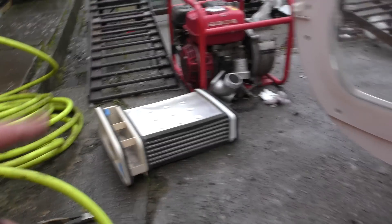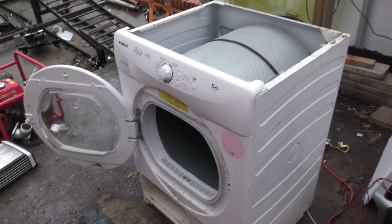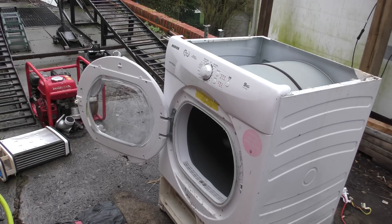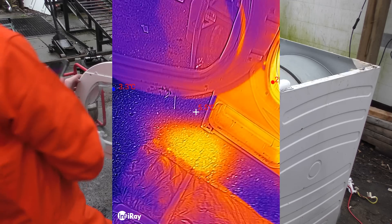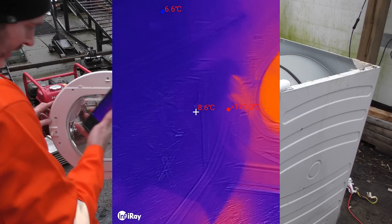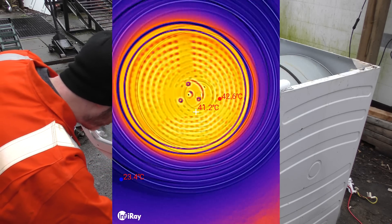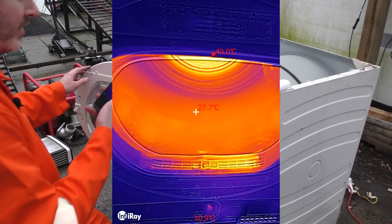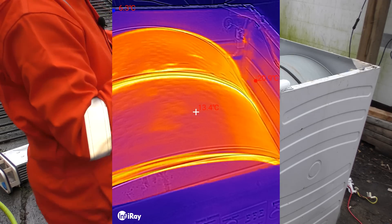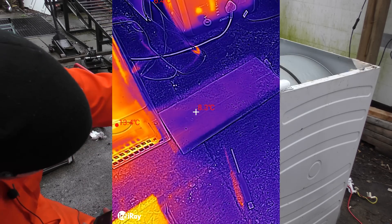So at the moment this is being a normally vented tumble dryer, as I'll explain once I've stopped it why we should just use a normal vented one. Let's get the thermal imager. We've got our nice hot diesel heater over here, output and hot air. And then we come inside the drum - we've got a nice hot back thing on the drum where the hot air's coming out. See the drum's hot in there. Can't really see it's too hot from this because it's shiny aluminium.